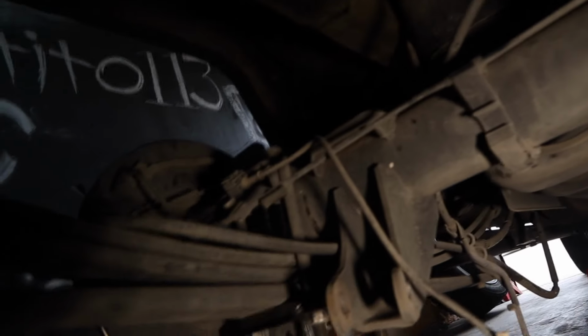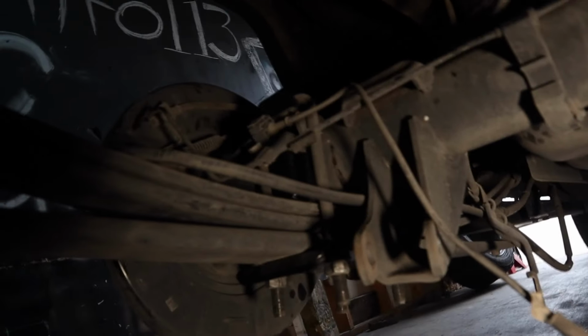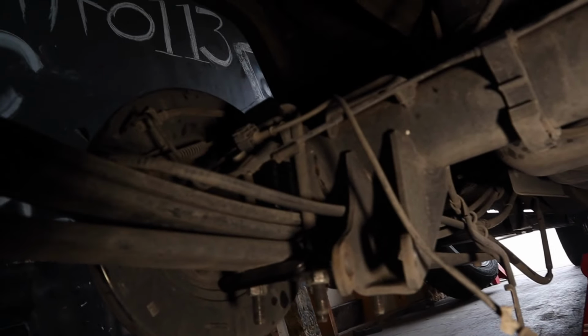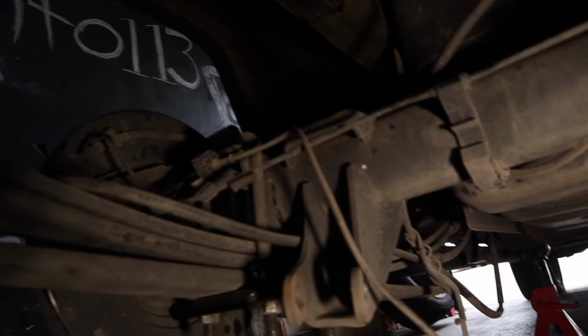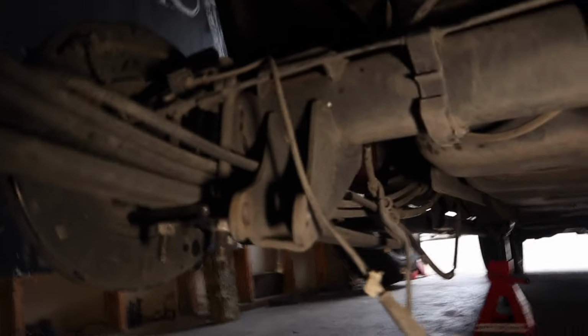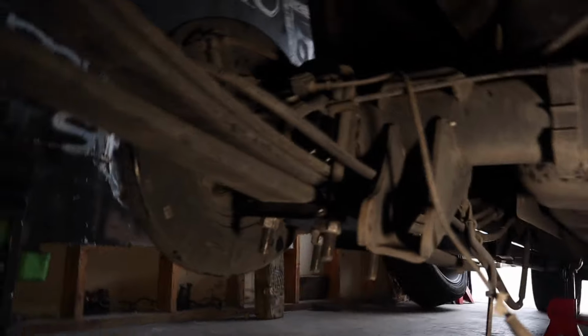and we'll see how the truck reacts, because I'm telling you guys, sometimes you can plug and play them and you won't have any problems. You don't have to do any of that computer stuff, but if something pops up, then you have to do like the reload. It's like a relearn process for it. So you download the file on your laptop and then you upload it to the OBD plug from your laptop to the truck, and then you should be set. I think a little green light shows up on the thing.